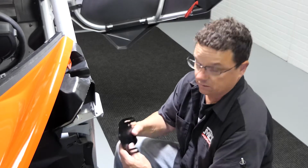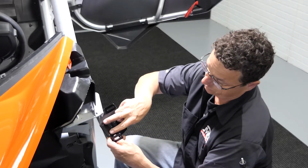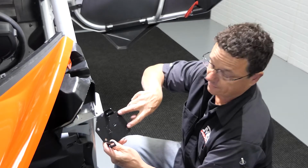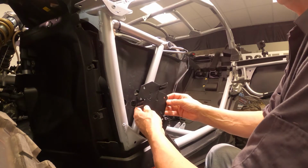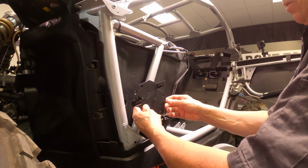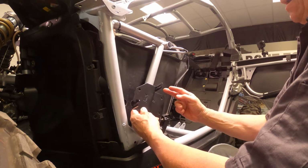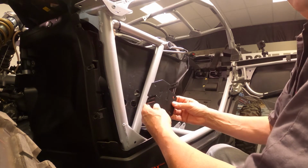Next, you'll notice on the mounting plate for the kick panels, you've got your 2 narrower holes and your 2 wider holes. The narrower holes, you can see by what you've drilled, go towards the back. So this is going to sit in like this. What we need to do is get a clamp here and a clamp here to mount this in there before we can mount the clips.